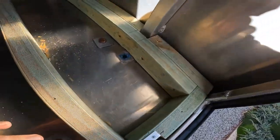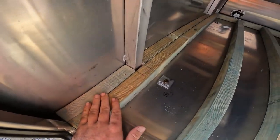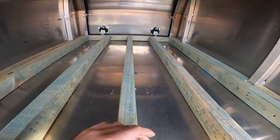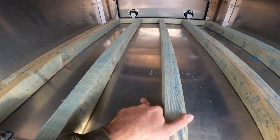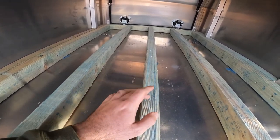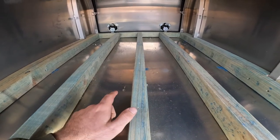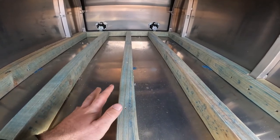We had to step it up so when we put a draw slide in it's not going to hit the bottom of the canopy. We put these bearers in and on the sides of the walls I've doubled both sides to strengthen it up. That's a big key point for these imported canopies — they use the aluminium sheet as the floor, so it's not the strongest for weight bearing. A lot of custom-made canopies have a proper built-in floor. If you get one of these imported canopies you will have to build a subfloor, and it also strengthens it for mounting stuff.